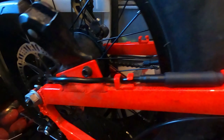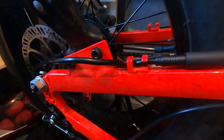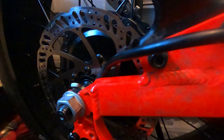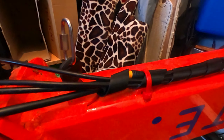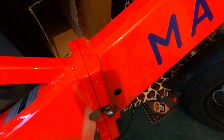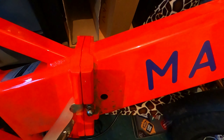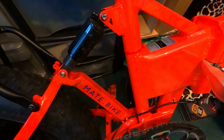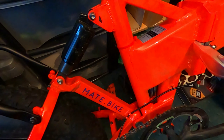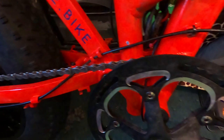I've got to put my front wheel back on. When I was running my motor it stopped working - I think the battery's run out as it hasn't been charged for a long time. I've removed the rear mudguard because it can be problematic and make noise. I've taken the battery out to charge it - the charger won't fit in the frame. It's on a slow charge at two amps, been on about two and a half hours, and it's at three bars, so it won't be done by five when the sun sets. The ride will be tomorrow.